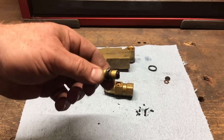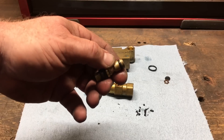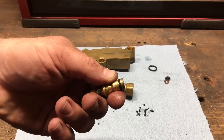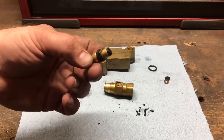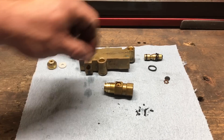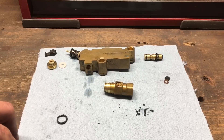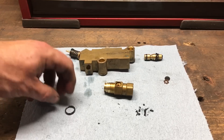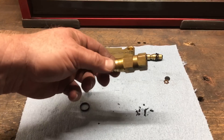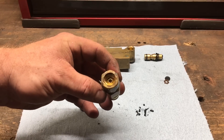If you look at this — this is the rear proportioning shuttle or valve — this thing is completely deteriorated and full of rubber fragments. The O-ring is torn and horribly misshapen on that part of the shuttle. This other one's not horrible but it is laid up a bit — you can see that gap in the video. All the O-rings inside this thing were just dying, like they weren't compatible with brake fluid, and I've only had new fresh brake fluid in this brake system since I first got it running.